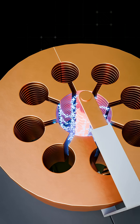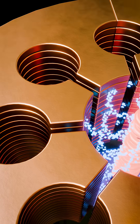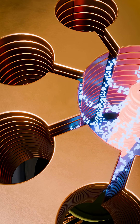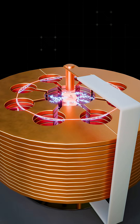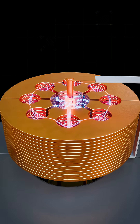These swirling electrons now zip past tiny metal chambers called cavity resonators. When the electrons pass by the cavities at just the right rhythm, they transfer energy and generate electromagnetic oscillations inside, building up powerful microwave energy at 2.4 gigahertz.